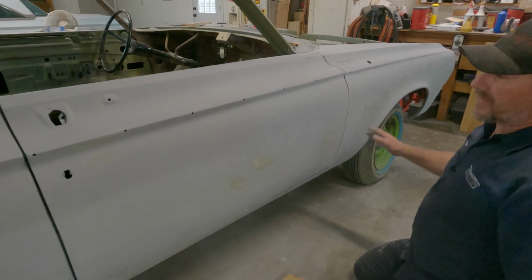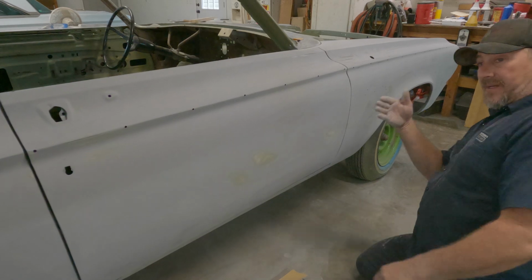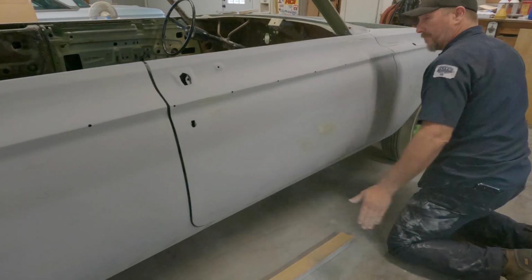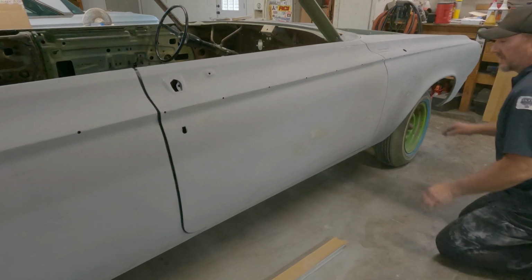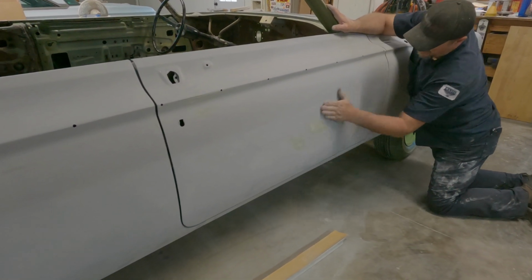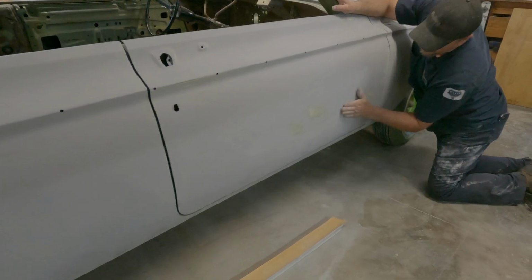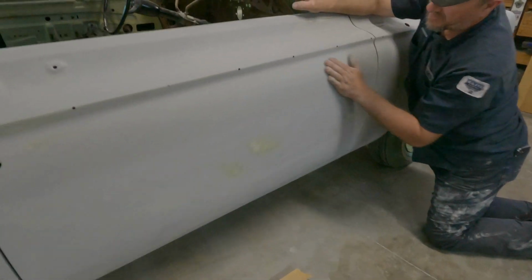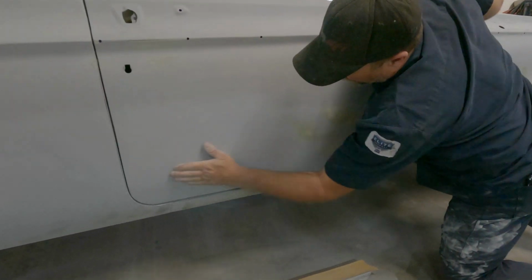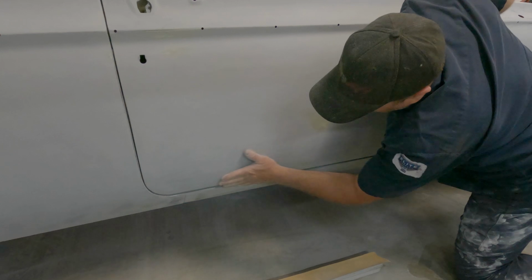You just do a wet rag too and wipe it all off and then get the sunlight on it. Okay. Look down and you'll have to move back and forth to see if there's any waves in it. So I should have been using the longboard first. Yeah, knock the longboard off first. That'll kind of show you where your spots are. Okay.